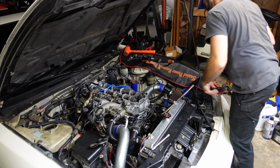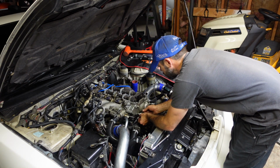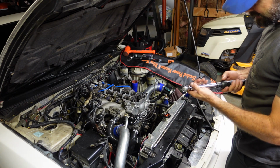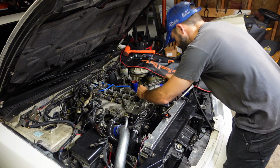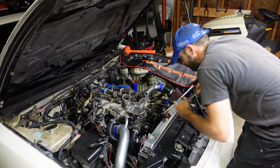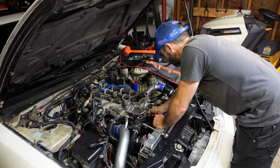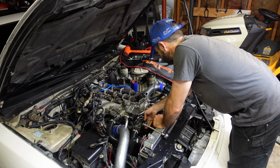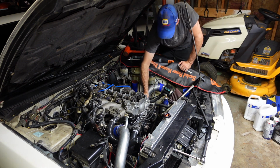We'll revamp and reset, get our bolt in for this other piece that holds our cooling lines for the turbo. And these little guys go to 66 inch-pounds. We got this one here. That one there is under cover. We just have to guess on that one. Add our torque. But, yeah, it doesn't need to be tight. Got belt clearance. Clearance on the bolts. There's one more back here in the back. It's hard to get to.